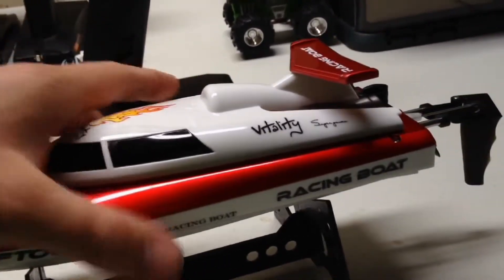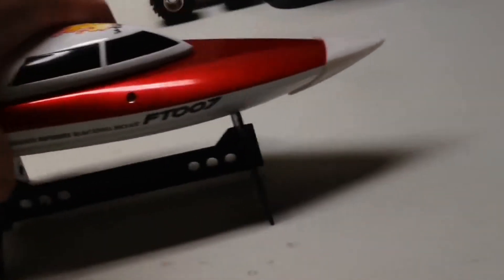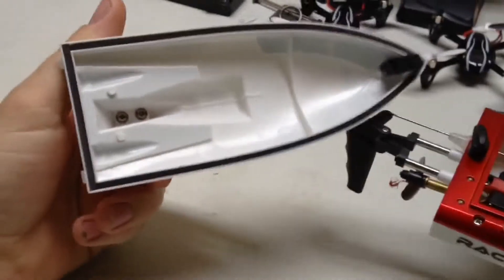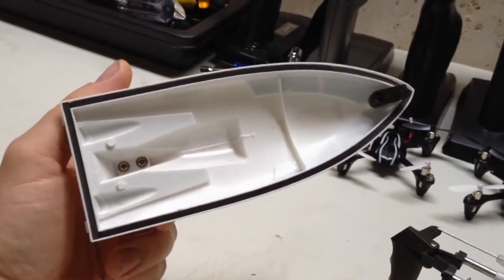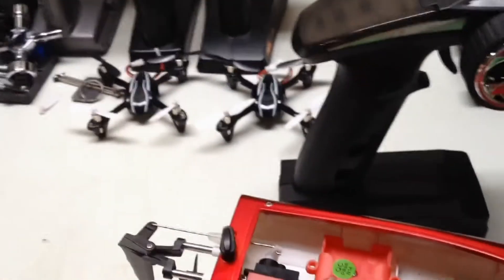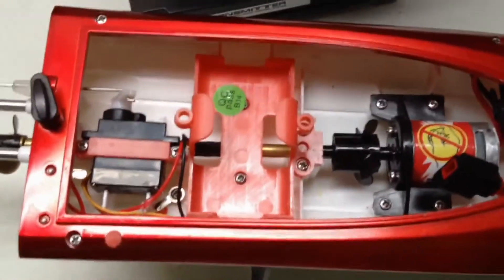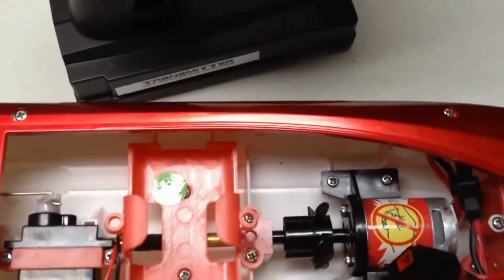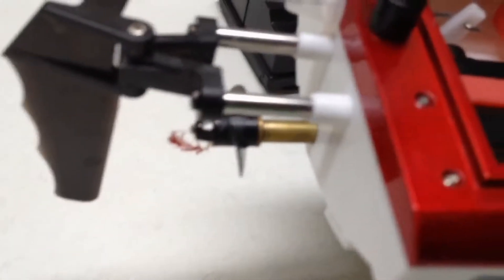I like this little stand so it's not just flopping around. I think it goes this way — yeah, it seems to fit better. As far as the seals go, I did glue them with super glue onto the cover so they don't fall off when I pull the cover on and off. A couple dabs along the way and it worked just fine. It does get a little water in here, but it stays at the bottom — I think the battery is raised off of that so it doesn't actually flood out. All your connectors over here are raised up too, so no water intrusion problems. The rest of it is plastic and brass, just like the out-drive.